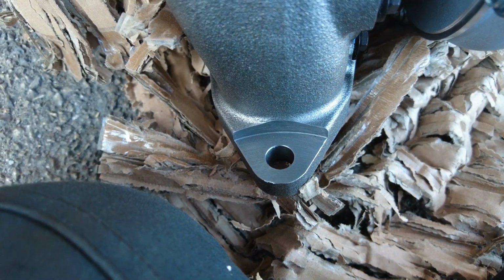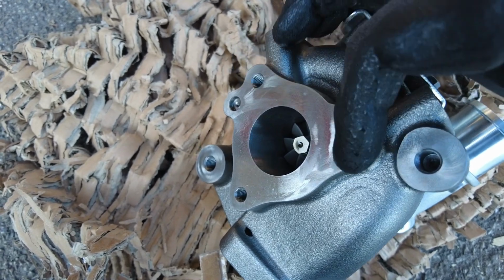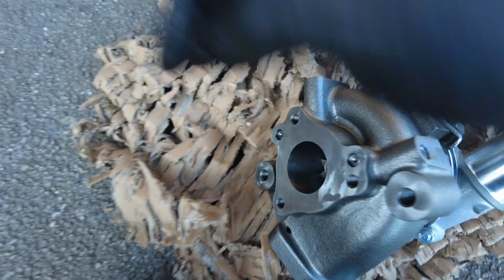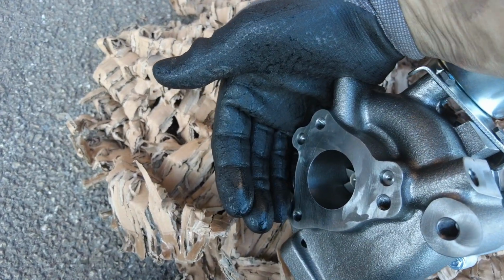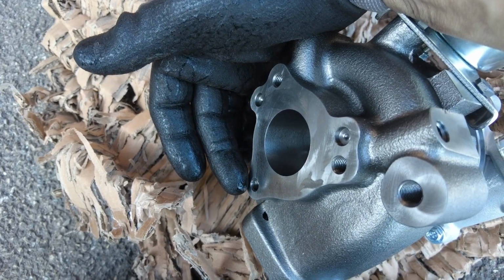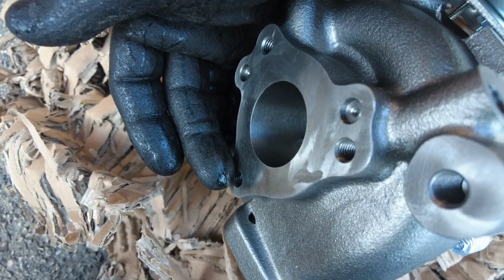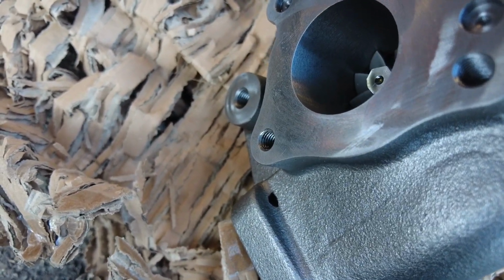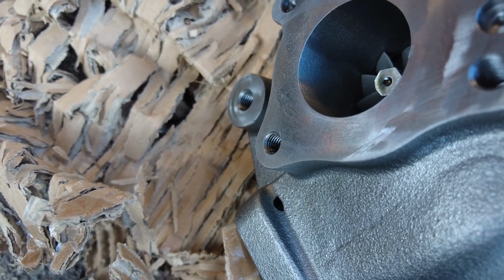It really was tricky. On the side here you have the triangle flange. The top ones there were pretty easy, but this bottom one's really hard to access. You kind of have to do it from behind and underneath, because of the firewall in the back of the engine bay. You have to use a short stubby screwdriver, or in my case I cut down a short small ratchet to do that one job, and I just had enough strength in my fingers to get that undone. Again, that was a real fight. That one took a while.